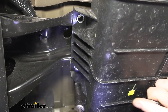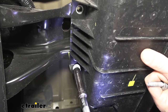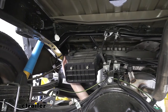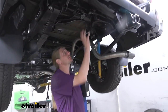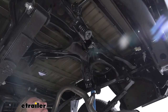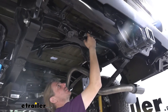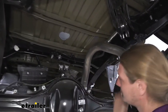When you remove the last bolt, just kind of support it, then gently lower it down and let it hang out. If you want, you can put a little bungee cord or strap on it to help relieve some tension off of the hoses that are attached to it. Also, to give ourselves some additional room, we went ahead and lowered down our spare tire. You can find information on lowering your spare tire in your owner's manual — you'll slide the tool through the square in the back and through the slot with the tools provided with your truck.